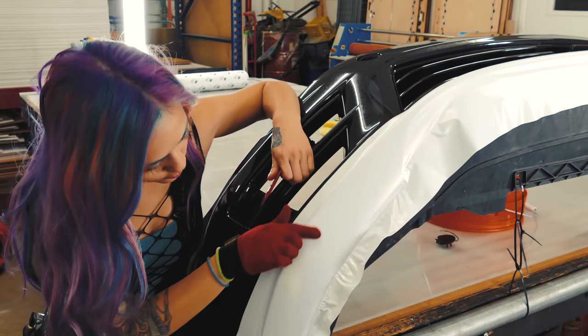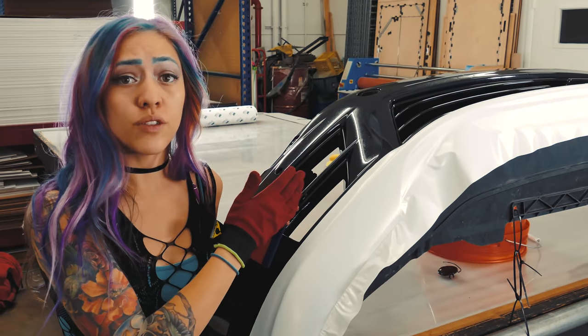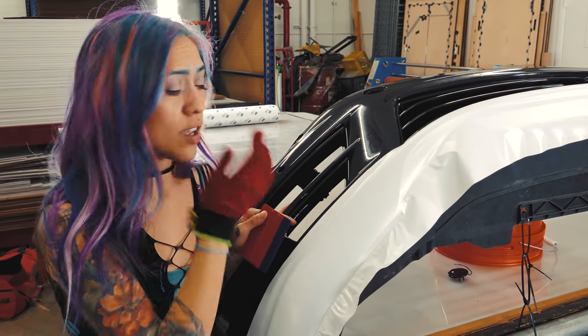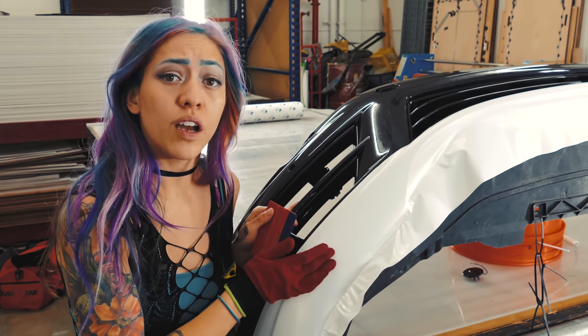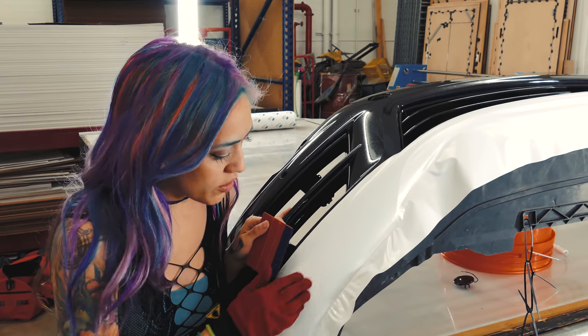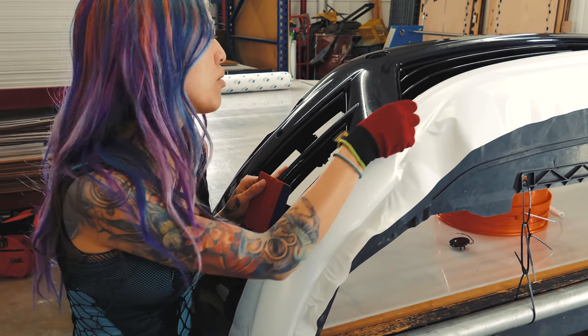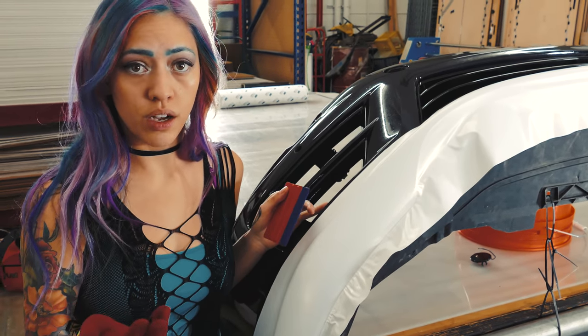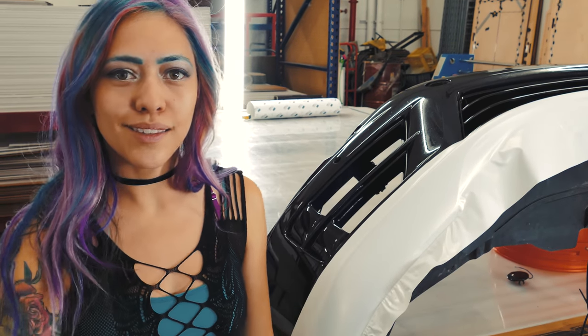You can see this is what rock chips look like with a wrap. We get a lot of questions on surface prep. This customer in particular did not want to do any surface prep. But if we were going to fix this bumper, what we would do is a basic wet sand — all that's gonna do is knock the edge of the rock chips off and make it smooth enough to wrap so you're not gonna see all this dirt and debris in it. We'd do like 1000 to 2000 grit wet sand on it, then a clay bar treatment to get all the contaminants off, and then we'd wrap it and it would look a lot better.